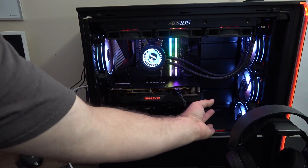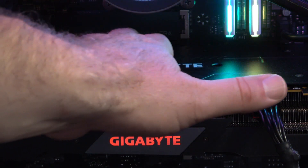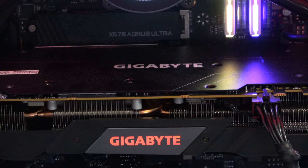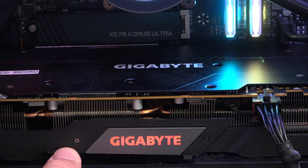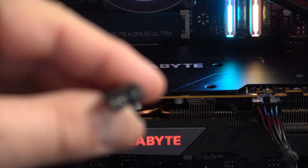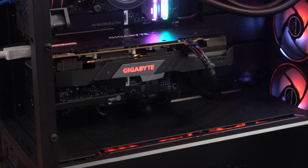As you can see, here's the video card — you can see a lot of sag on longer gaming cards. You want to support it because it's putting a lot of pressure on your PCIe slot. If you reef on it hard enough it will crack something. So this support goes in like this, jacks up the video card, and the nice length means it covers pretty much the full length of the card — it won't overhang awkwardly. It is addressable ARGB, so you will need an addressable header on your motherboard.